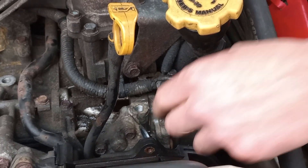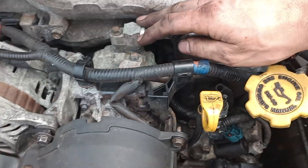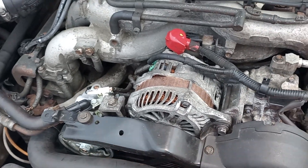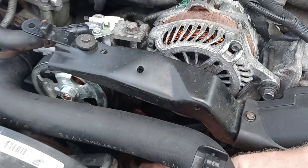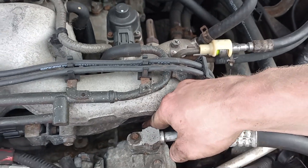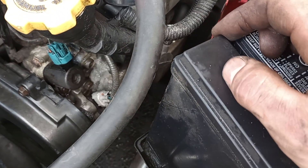To get the best access to the patch area, you should probably remove the AC pump. That involves taking out this bracket — just that bolt and that bolt — and pulling off this shield. The alternator comes out with this bolt, and there's one bolt down on the tensioner you have to loosen up. Take off the belt, take off the alternator, and there are four bolts for the compressor. Probably take out the battery too for a little more visibility of the crack.